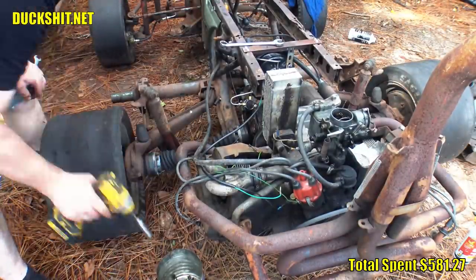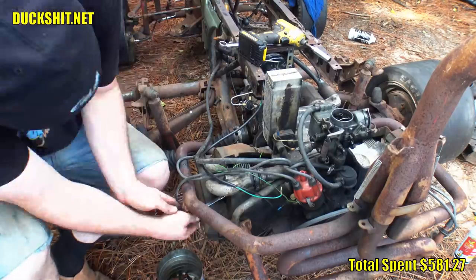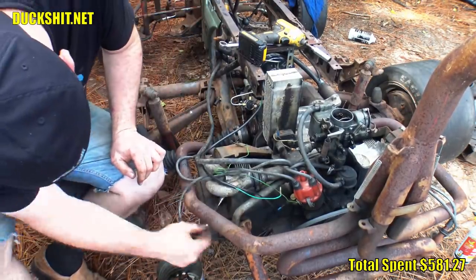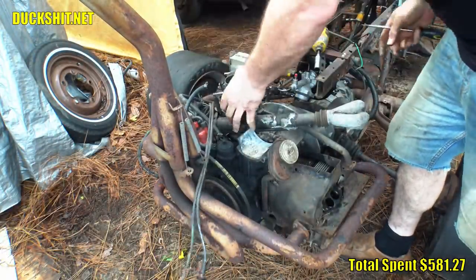Since I had to drill it out anyway, it made sense just to remove the entire manifold. No sense in getting shrapnel in the engine and fouling up the distributor coil, fuel pump, and all the other crap on the left side of the engine in the process of drilling and welding. This is a task I really don't like. It's fiddly, and a lot of things need to come apart just to get them out of the way. The throttle cable, the fuel and vacuum lines, the end castings, the shroud, the alternator, the carburetor, just a nuisance.